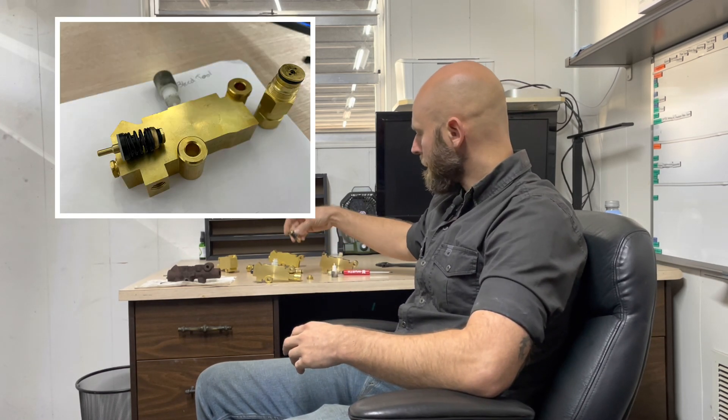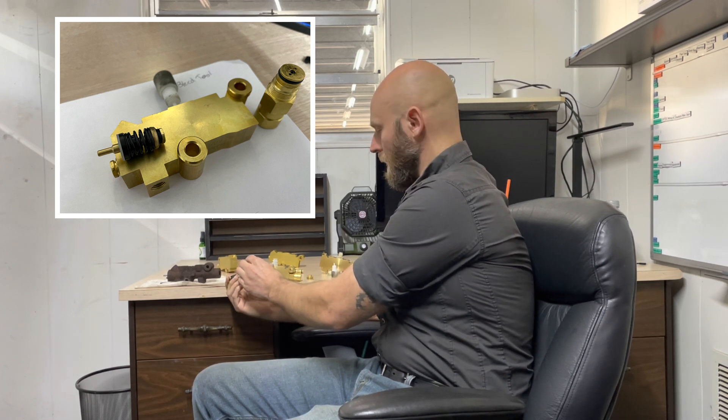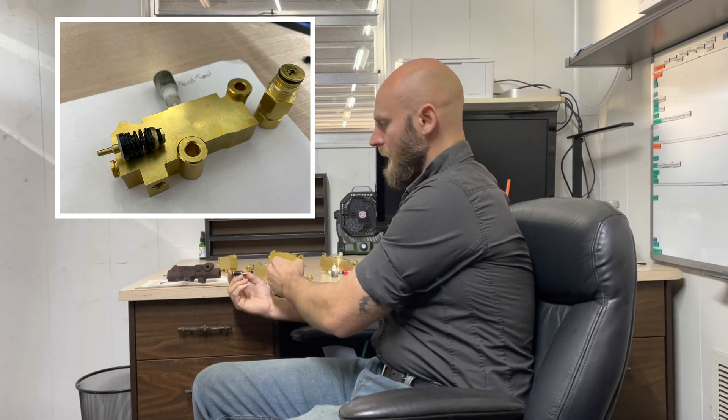Our coaches have disc brakes in the front and drum brakes in the rear from the factory. Some people have converted them over to disc and disc or some other setup, but I'm just going over what the original setup is today. With the rear brakes, this thing helps take up some of the slack in the rear brakes before applying brakes to the front. Inside of this there's a little spring piece. As the fluid's coming in, it's going to pressurize both sides at the same time, but it's going to take up the slack in the rear first, and then it's going to apply the brakes pretty much evenly across the board. It's a 60/40 split, so it's not 50/50 front and rear.